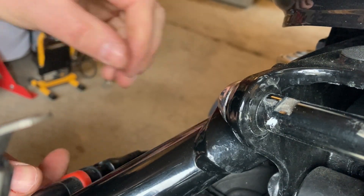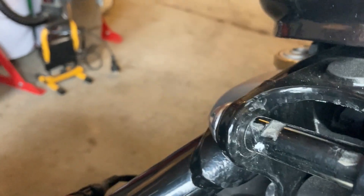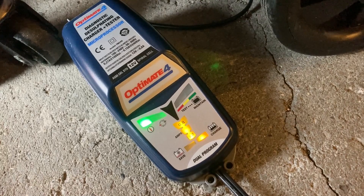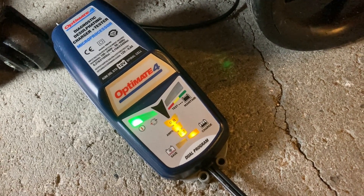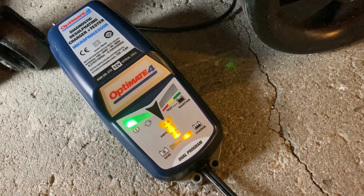The update requires a minimum voltage of 12.5V, which will be supported by plugging in your maintenance charger. We have it here — it's plugged in — and you can see it's starting its initial diagnostic and then switching on to providing power supply for the system.